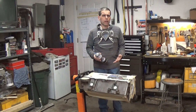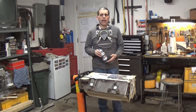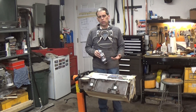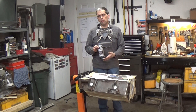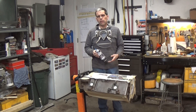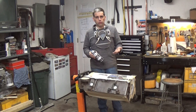Now that I'm finished taping and papering, before paint I want to put a primer down first. The primer serves two purposes: it acts as a rust barrier between the cast iron and the regular paint, and it promotes adhesion so the paint sticks really well. I'm going to use a Dupli-Color specific primer that's heat resistant up to 500 degrees — perfect for this engine block. This is definitely a respirator job, especially when you're indoors.